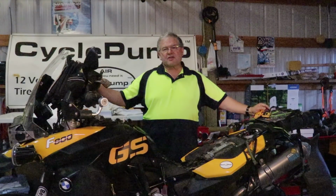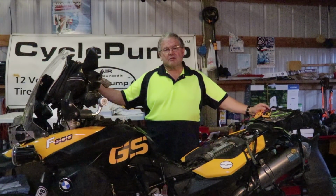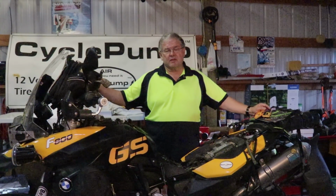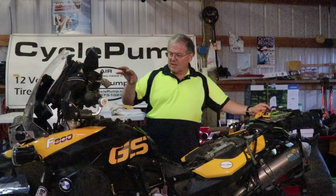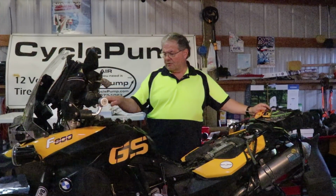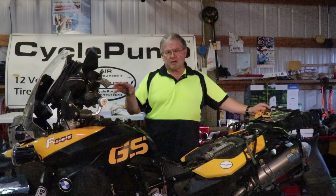So we've gone through the process of the installation. Actually putting the inserts in the signals was fairly easy. We did encounter some issues with those eBay lookalikes. I'll cover that in other parts of the video, some trimming, some things we had to do. But we've got our command wire running to the front off of a running light in the headlight. We've got it hooked to the turn signals in front. We have a brilliant white driving light, and then we have the signals.